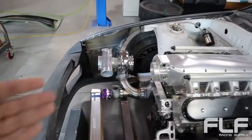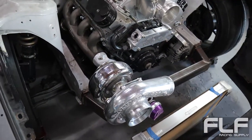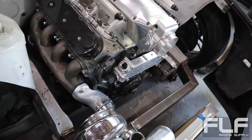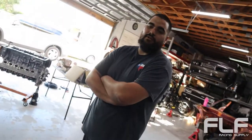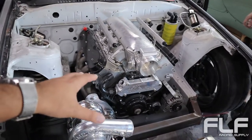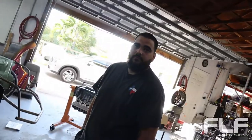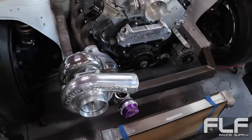It's not that big to begin with, and no oil lines, so you don't have to worry about the return. It keeps it nice and simple - you don't have to worry about feed, drain. If there is ever an oil failure, it saves the turbo. If for whatever reason there's an issue and you spin a rod bearing, you'd have to worry about replacing your whole turbocharger, so it saves you a lot of headache.